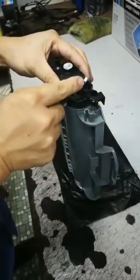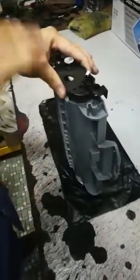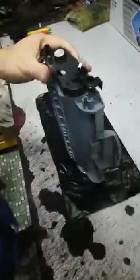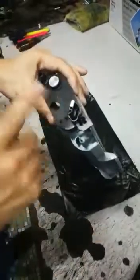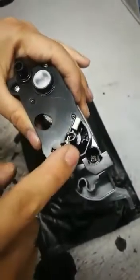Move the sensor back to the left hand side, and only then insert the toner into the printer. The printer will then be able to detect the toner. This is the correct position — sensor on the left. If it has been moved to the right, you need to fix it.